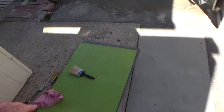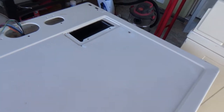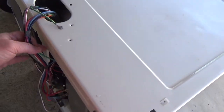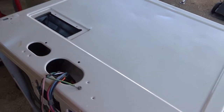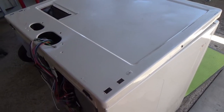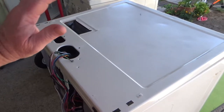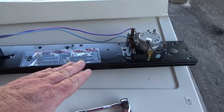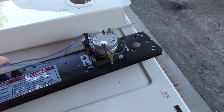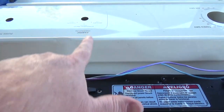I'm ready to start figuring out how to wire up the front panel again. A tip: never grab the control panel or put pressure on it — they'll break off, they're just little plastic tabs. Somebody broke them on this one before me. On the back of the control panel, I leave the reference piece visible so I can see where the gauges go — this bar is probably used for different machines and they line up at specific spots.